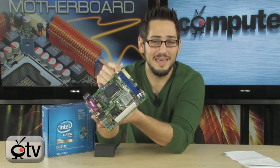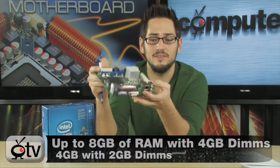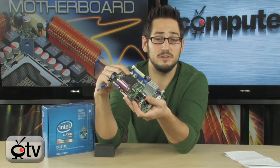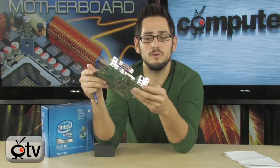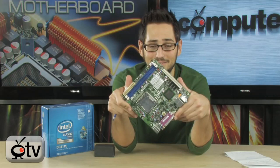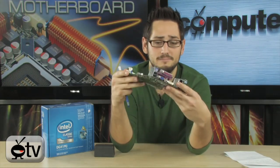It will support up to 8GB of RAM if you have 4GB DIMMs, but most likely you're going to use two 2GB DIMMs — up to 4GB — and throw, let's say, a Q6600 on there, and you're going to have a computer that's actually pretty fast. Faster than most people's computers, with a quad core in a package that's this small. I mean, this is like a coaster — it's really small and pretty impressive.